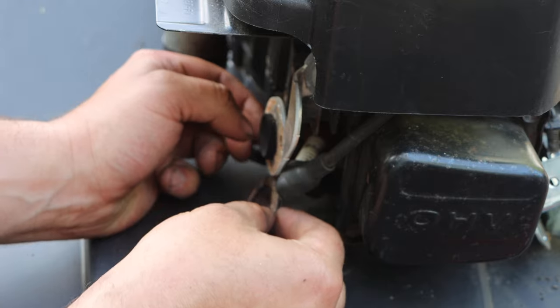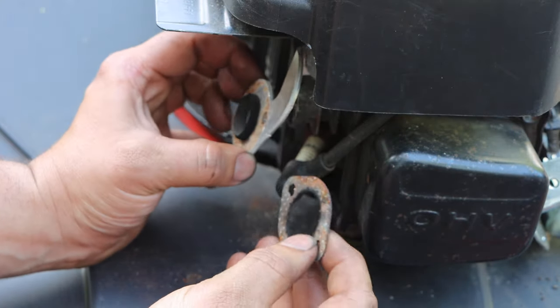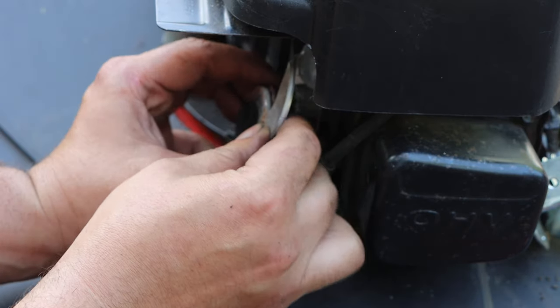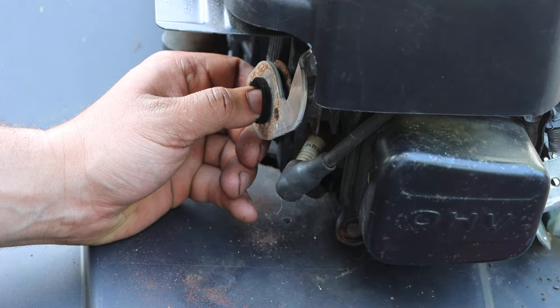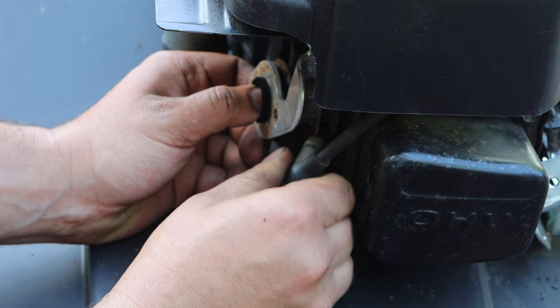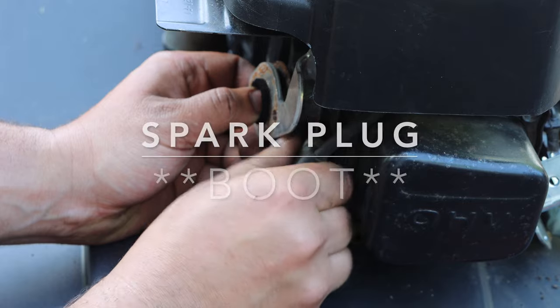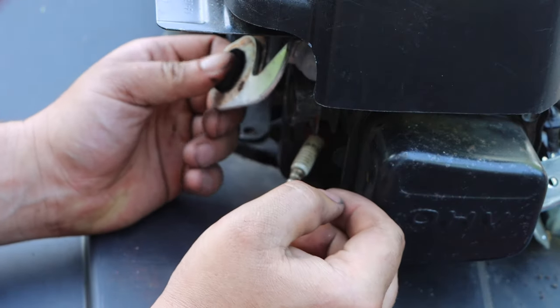Now we're gonna pay attention. Remember talking about paying attention? Look, there's another gasket in the back of this, and this holds up to our thermostatic choke lever. As the exhaust gets hot, this will pull out the choke. We're going to remove the spark plug, right, Uncle Rob? Okay, and now, basically, our head should be free.